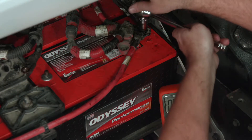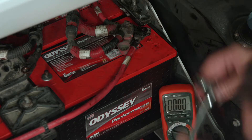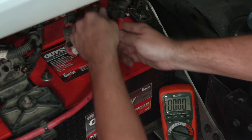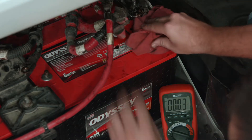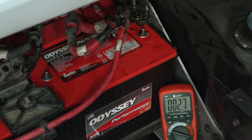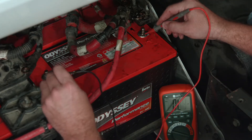Finally, for a full evaluation, it is best practice to read each battery's voltage individually. Remove the cables or cable harness and clean the battery terminals. You should always check the Odyssey manual before attempting to use any type of chemical spray or cleaner, as certain types of sprays or cleaners can damage the ABS plastic that the Odyssey battery case is made of. Simply wipe down the terminal area, removing the dirt and debris before reading the battery's voltage.